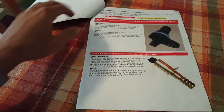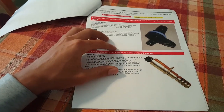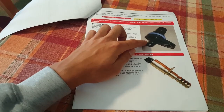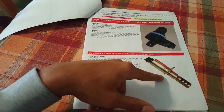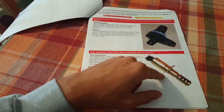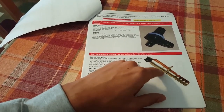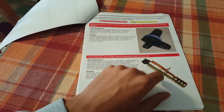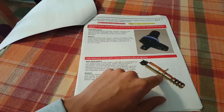This is what was wrong with the car — what was causing the check engine light. This right here is the camshaft sensor; this is exactly what it looks like for this car. These are the two solenoids you'll need to replace. This is not exactly what they look like for this car — it's similar but not exact. If you go on eBay and type in 2008, 2009, or 2010 BMW 528i cam solenoid or VANOS solenoid, it'll pull up exactly what you need.